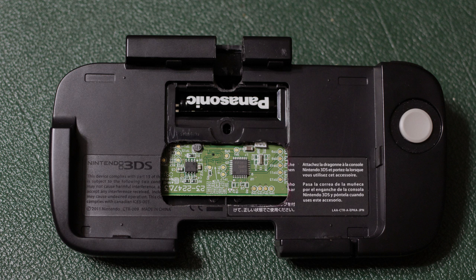I will be giving you guys the measurements for the cuts that need to be made on the CirclePad Pro. These are the measurements for the area where the capture board sits on top of the CirclePad Pro. I really recommend that you take apart the CirclePad Pro before you make the cut — if you don't, you run the risk of cutting into the motherboard, which renders the CirclePad Pro useless. Just take your time, make sure you measure properly and accurately. The measurements for the area are 52mm high and 57mm wide.